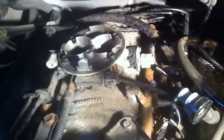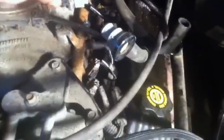And go ahead and take it off back there. That's what I'm going to do right now, and then we're going to match it up. Just a few things that are going to make this a lot easier on you. Obviously, you take off your air cleaner. You know how to do that. Just loosen up the ring on the back and you can just pop it off. It clicks on a couple of different places, but you just pick it straight up. It should come right off.